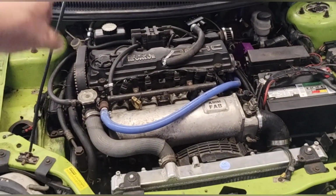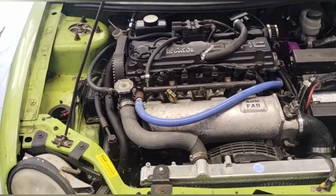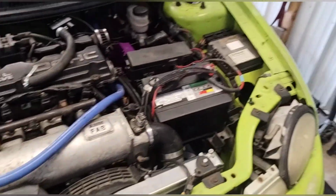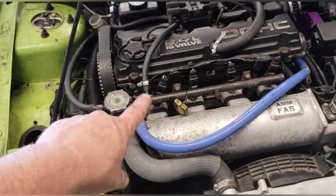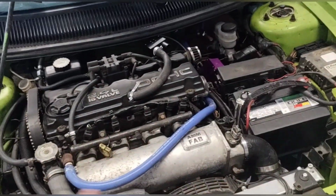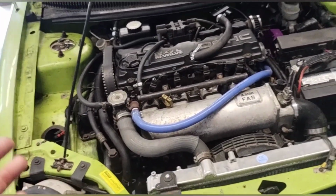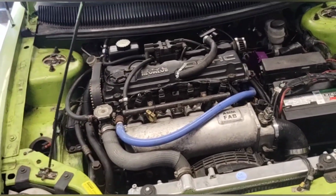You can use your 2-liter dual cam header. Obviously, we already did that. We dynoed it. It doesn't make a lot of power. We're trying to go faster. So, dual cam Mopar ECU for a 95. These are Mustang injectors with adapters so that the air fuels are right, because you need approximately, I think it's 20% more fuel. It's kind of like E85, but you just need more fuel because of the bigger displacement motor.